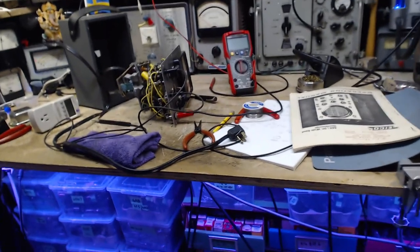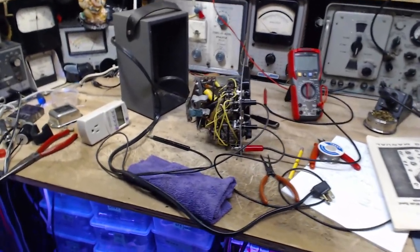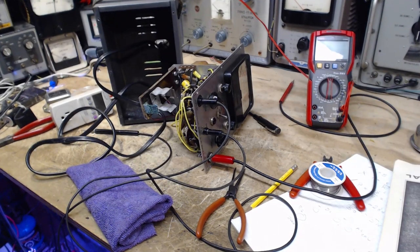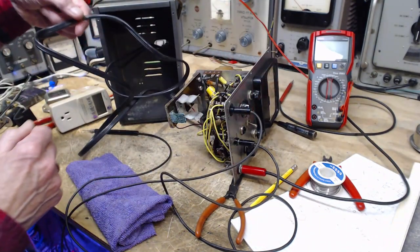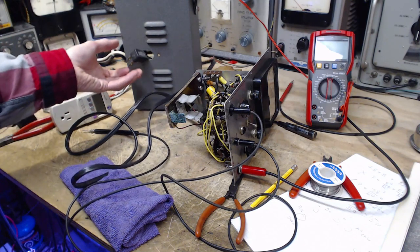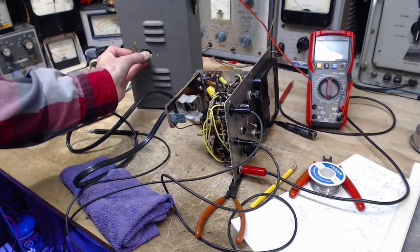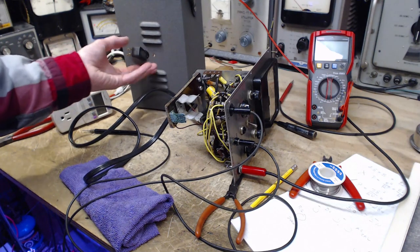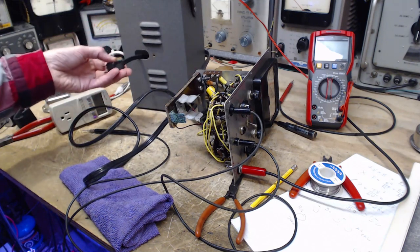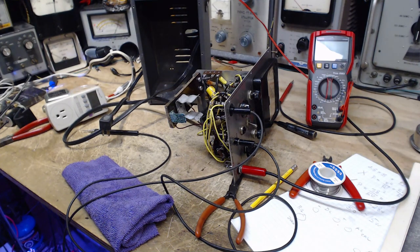I don't know if I want to pursue this any further. Something kind of funny here - did somebody put on a three-prong plug from a device that originally had just a two-pronger, non-polarized? The answer is probably yes, because I'm trying to take the cord out and this plug won't go through the hole. Whoever did it must have fed the cord through here first, and probably soldered it up and then went 'oh, I can't get the button.' I'd like to get the cord out because I want to dump the junk out of it.